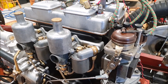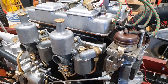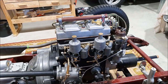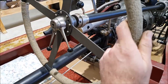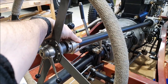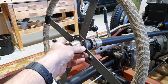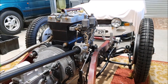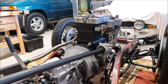I did check that it gives me from zero advance to close to 30 degrees, which I think is actually too much — but better to have too much than too little. The leather washers in the system are working to make it so that you can turn the steering wheel without disturbing the lever positions. It's a bit stiff when it's not moving, and it's also obviously missing a bracket at the top end of the column which will stiffen all of this up once the body's in place. But this outer lever does move nicely — the motion's nice and smooth, so I think that'll work.